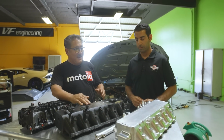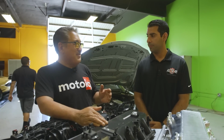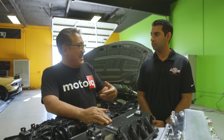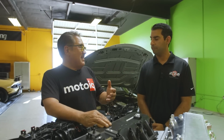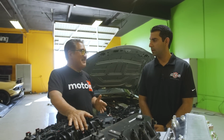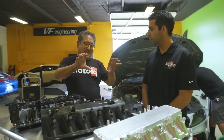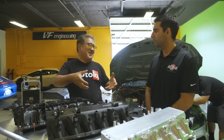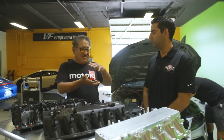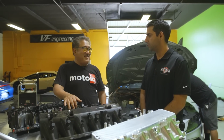So on the dyno, we saw 100 to 120 degree charge air difference across the core, and we also found really quick recovery after the dyno pull. Like by the time the dyno wound down and we're getting ready to make another one, it just about recovered almost to the regular condition. Now that's super impressive. Normally I'm not a fan of water to air, generally because you can't get that frontal area, and although the heat exchanger itself is more efficient, you're usually so limited in area it kind of is less than a wash. But man, this thing kicks ass.